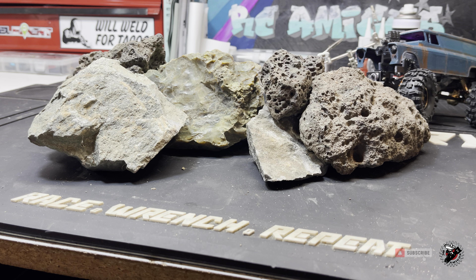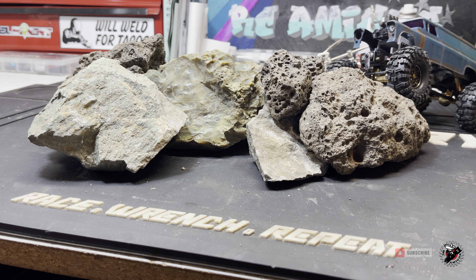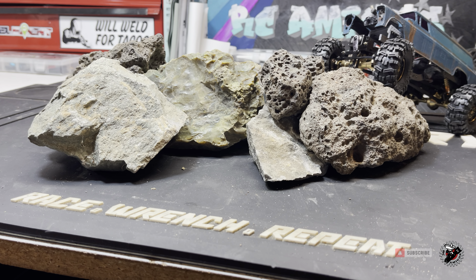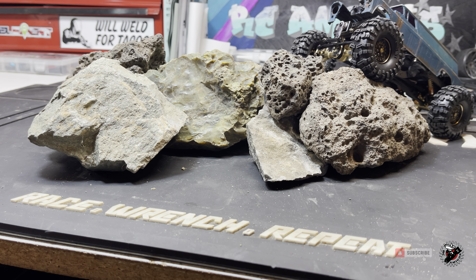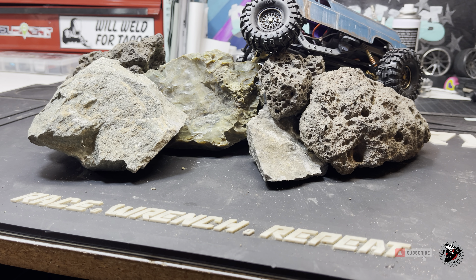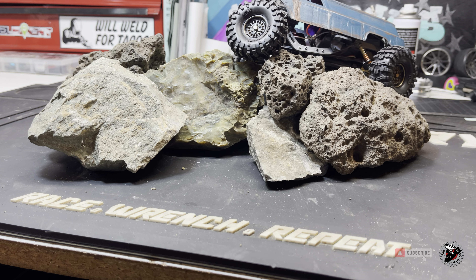Let's get this thing on the rocks. I love the slow creepy-crawly — this thing just walks right up. I've been waiting a while to get this back on the rocks. Hopefully I can set up some more mini rock gardens soon. This rear steer is really awesome — I've got the Mighty Chihuahua up front and the Reefs Micro 99 out back, running off the GT5. I use one of the dials — I think channel 5 — for the rear steer, and a thumbstick to steer the front so I can time it up just right.